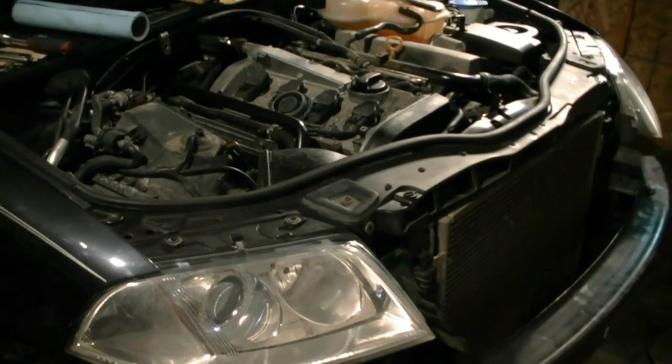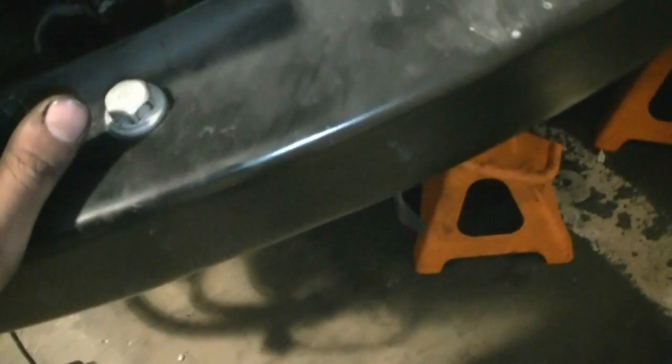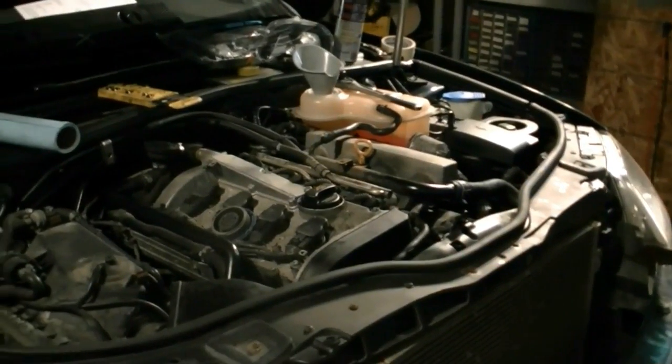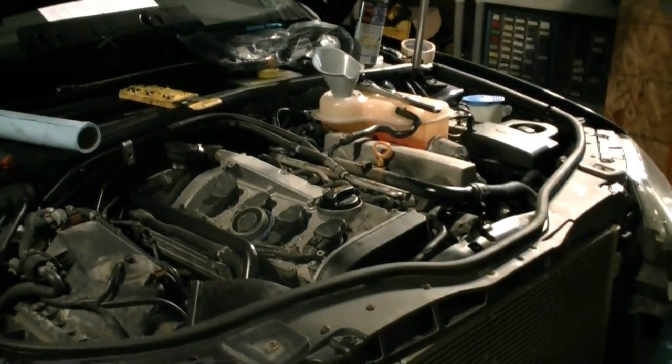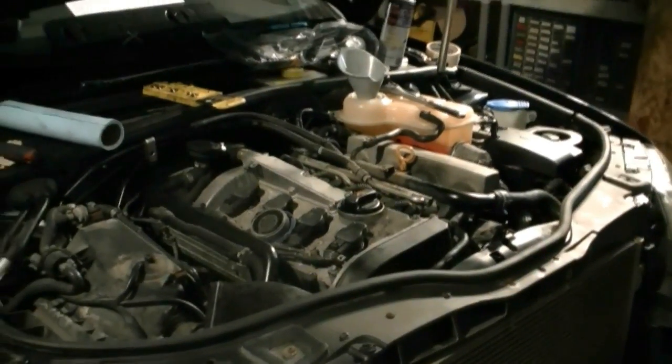While putting the car back together I didn't run into any problems. One thing I want to point out: if you want your headlights and fenders to line up correctly, before you lock down the shock absorbers that connect to your front bumper, have someone either pull up on the lock carrier or get your knee underneath it and push it up as you're tightening down one of those screws. That way you can adjust it and make sure it lines up correctly, otherwise it's going to look like your car's been in an accident. Hope this video helps — if you like it, give it a thumbs up, leave comments or questions below, and see you next time.